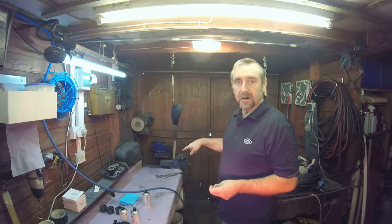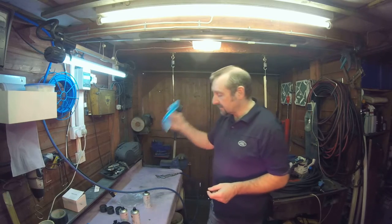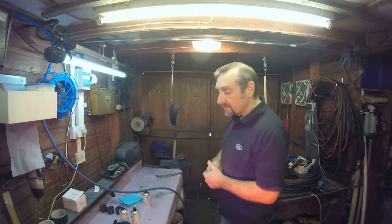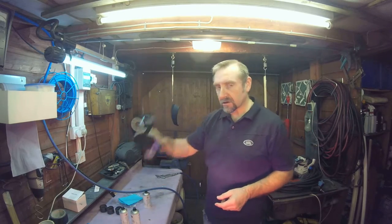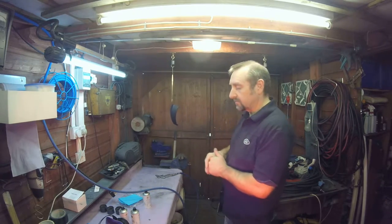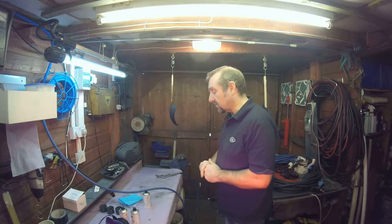I will now blow off with some high pressure air. I'll tack rag with a new tack rag. For the first part of painting, I won't put the mask on. I'll try and talk to you guys and try and talk through a few bits and pieces. I will have the fan on, so any nasties will be sucked out my way.